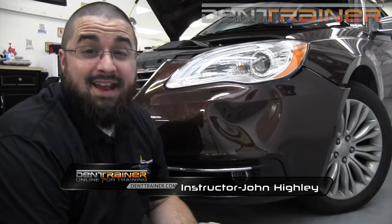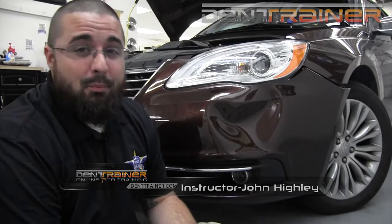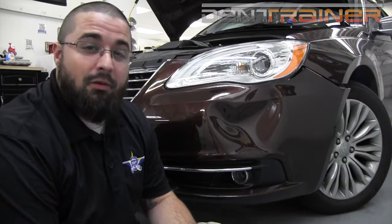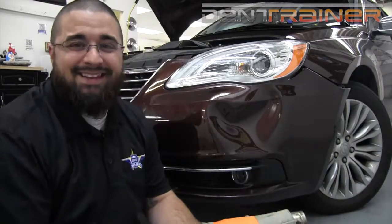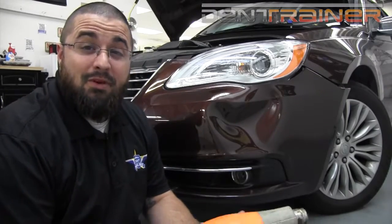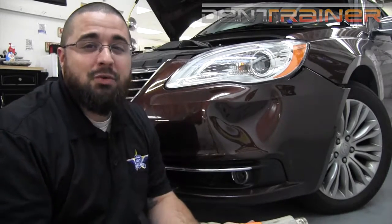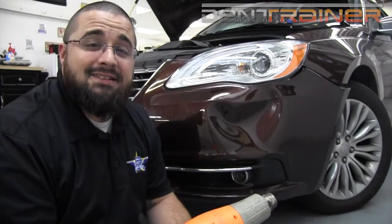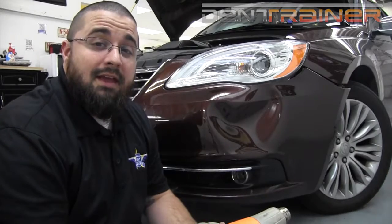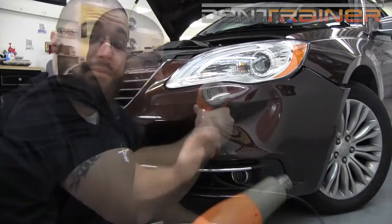All right, everybody, one of the first things that you're going to notice is that, hey, he's not using the tapper. That's because if you use a tapper on a hot bumper, it will leave a divot in every little spot that you hit. You got to find things like your hands. So what I'm going to be using here on this one, I'm going to start out by working it with my hands. There's other techniques to pinpoint pressure without leaving a divot, and we'll get into that here in just a little while. So I'm going to go ahead and start heating this thing up all the way around and putting a lot of concentration on this hard crown on this end.